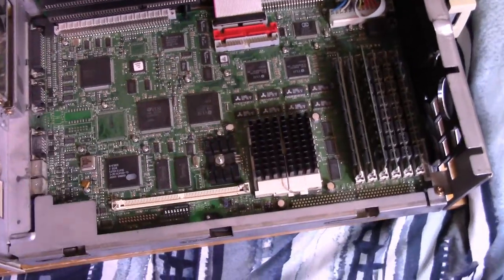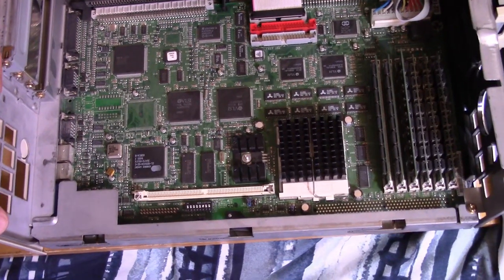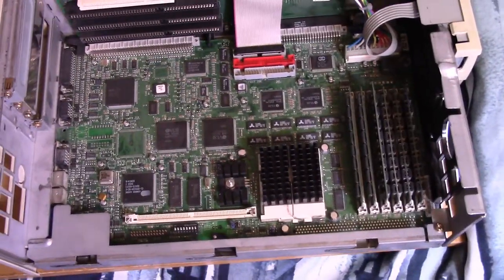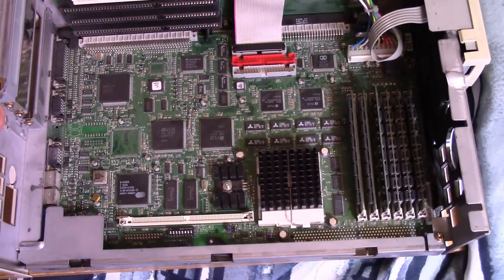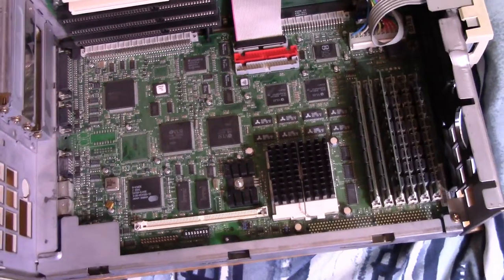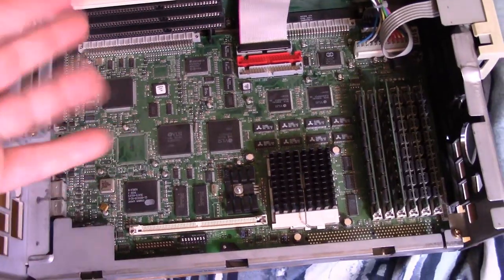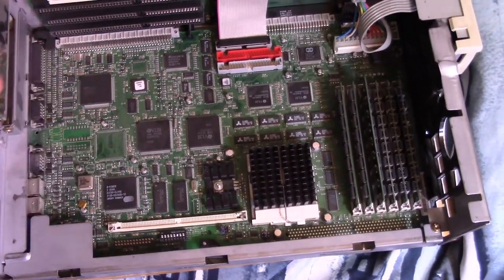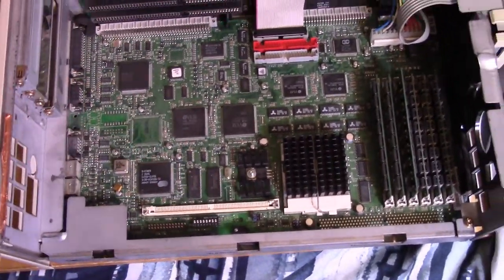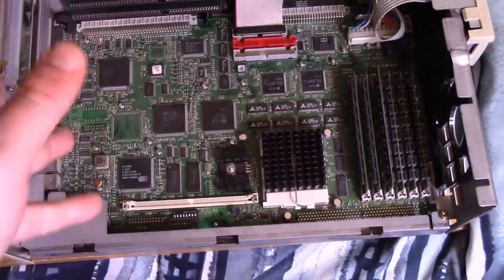It wasn't around very long. I think it officially supports up to the Pentium 120 megahertz, although depending on the board, some support the 133, and some boards support some of the later K5s. I believe as fast as you can go on certain Socket 5s is, I think, a K6 233, maybe. And there are some overdrive CPUs, which we'll talk about in a second, and things like that. But it's kind of pointless. Socket 7 does everything this does, but better. Correct me if I'm wrong on any points there.